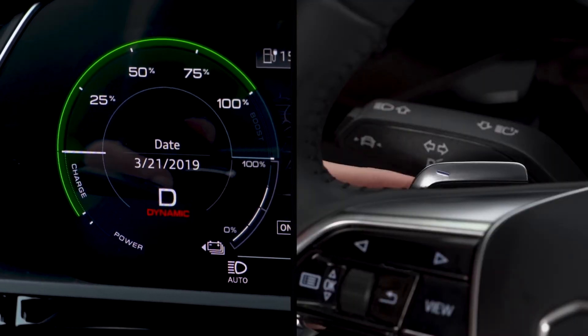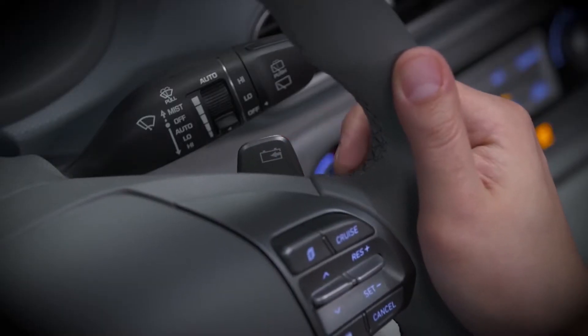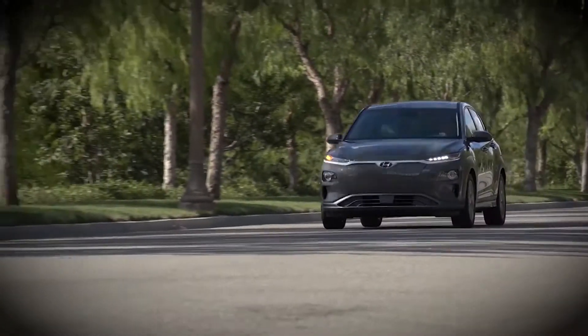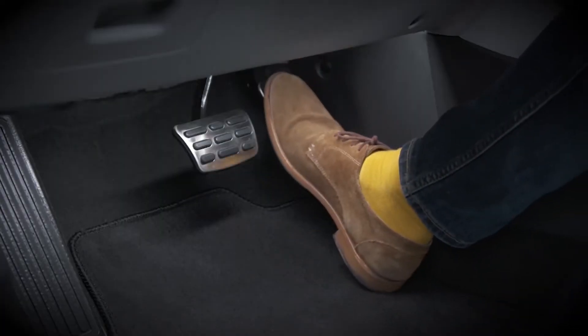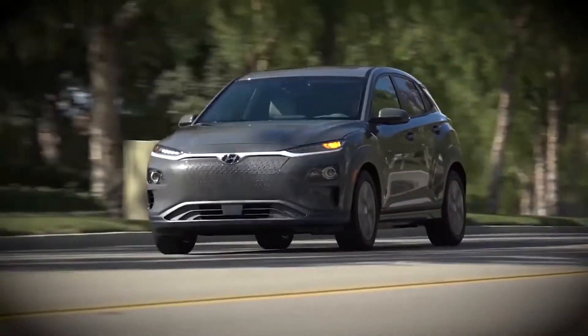There's no point in going through every EV on the road because they're all so different. Most cars allow you to set the severity of the regen in some ways. Some cars have a simple heavy or soft setting — in other words, how quickly do you want to slow down. Other cars allow you to control the severity using flappy paddles behind the steering wheel. I really like the way that the Hyundai and Kia cars do it — there are often three, four, five, sometimes six options, the sixth being freewheeling. On some of those cars you can pull a paddle behind the steering wheel and even bring yourself to a complete standstill, never using the friction brakes — not using up your brake pads or generating heat, but putting all of that energy back into the battery.